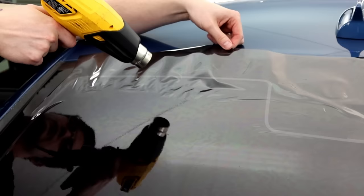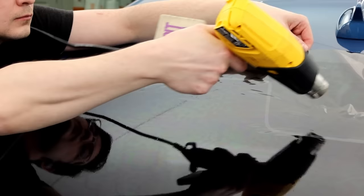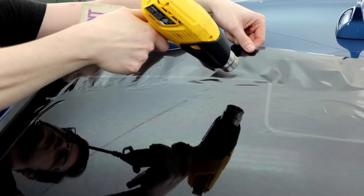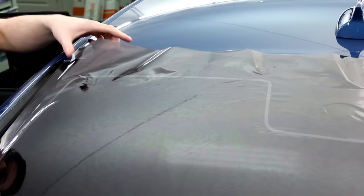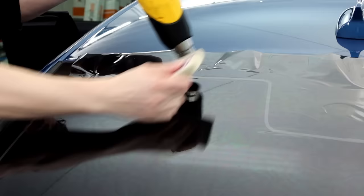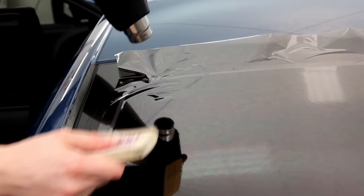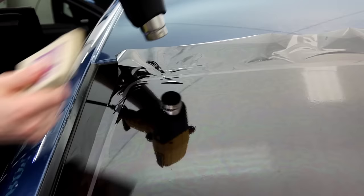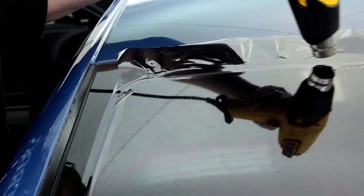This is where I actually work myself into a little bit of a problem. I had a client waiting up front and I'm trying to shrink this Charger back window for this video, and I get into the last part of it. Mind you, I still have to go back through with the film that the client actually bought — I was making this video with this film and then I was going to swap it out for Pro Classic 20 on the back. So this is the Lexan HSA 20%. You can see right there — I do basically the exact same thing that the student did right there. I just put too much heat in one particular spot, and that's where you can see this pinch point starting to form. It's past the line, so it's probably going to be okay. But I'm going to sweep these fingers out and this is exactly what happens: you put a little bit too much heat in one particular spot, but you needed a lot of heat to begin with to shrink this film down. And then it all starts creasing together right there, and there's no way to recover from that. That is done.